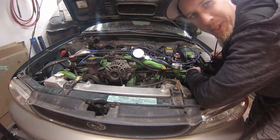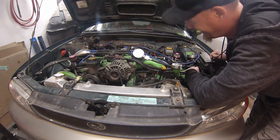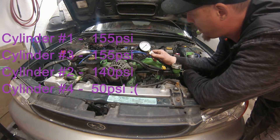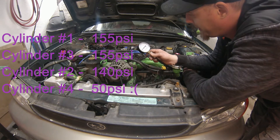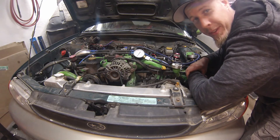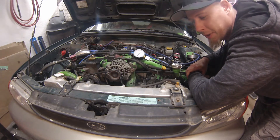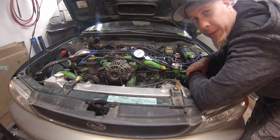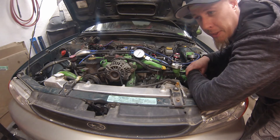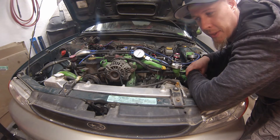We've got a major problem with number four. Number four has hit 50 psi after extended cranking, so I would say the exact same thing that happened to Tyler has happened to me, and number four piston is probably cracked. Being an NA motor with NA pistons, that's probably what the noise is being created from. That piston is actually severely cracked.